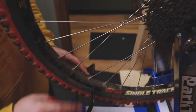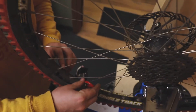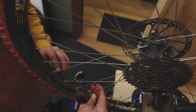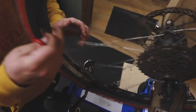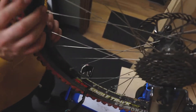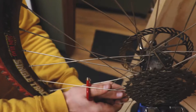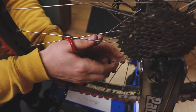It's still touching this side, so I want it to go over here. I'm going to loosen this one, tighten this one, loosen this one. Voila. Now you want to set that true — put it under tension. Squeeze parallel spokes and be kind of hard on it. Squeeze them to tighten and make sure that your spokes set and that everything is in working order.